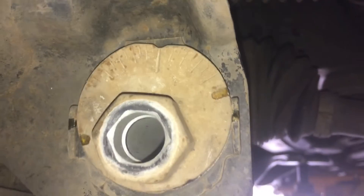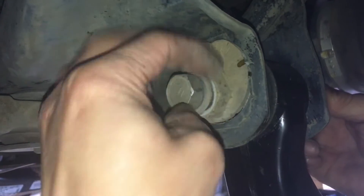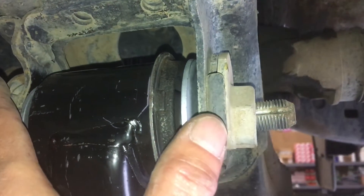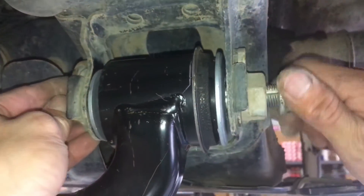The front one — this is just the adjuster, that's what's used to adjust the wheel alignment. What do they call it — eccentric. See, we've marked it because we're just putting it back where it was. The bolt goes through, but with the front one the nut goes on — but see, you've got to screw it so that is what doesn't turn on the front one. Just think of it: outwards at the front, it's the bolt — so furthest outwards, front, you undo the bolt on the front one. On the rear, you undo the nut. So at the front — the bolt; don't turn this nut. And on the rear, don't turn on the outside. We could be wrong though, so we reserve the right to be wrong — you should always double check your information.